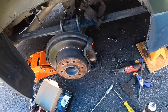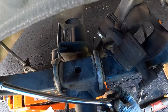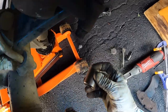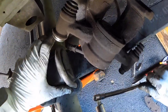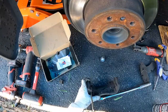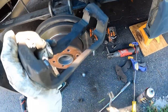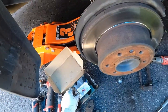To get the disc off, first thing is I'm going to use a 13/16 socket on the top bracket bolt. I like to tap the socket on because of the brake dust, then break it free. Then take off the bottom bolt — 13/16 as well, lots of brake dust. After you get the bracket off, pop off all the old slide hardware. Then wire brush the surfaces where the slide hardware was seated — you want them to look pretty clean, just knocking off any heavy brake dust.